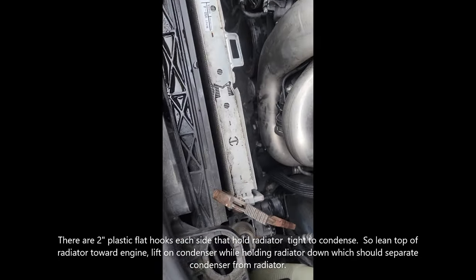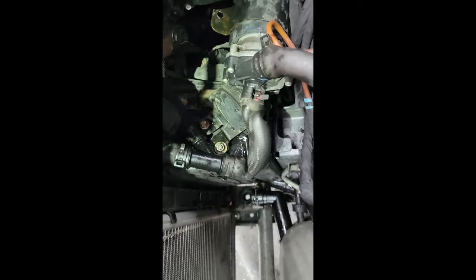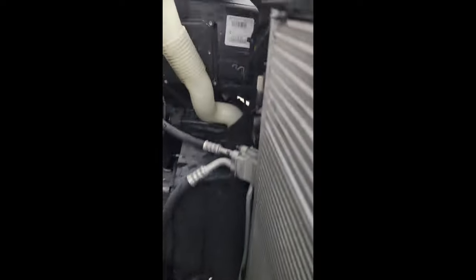This is what it looks like — this is just for the winter wiper area, there was a Torx 12. I pushed it back to give myself more room for the new one. These are all push-ins for the automatic transmission. This is that rubber bushing at the bottom of the radiator — the ball goes into it and snaps in right here. The new one snaps into that on both sides, and it's not far from the bottom.